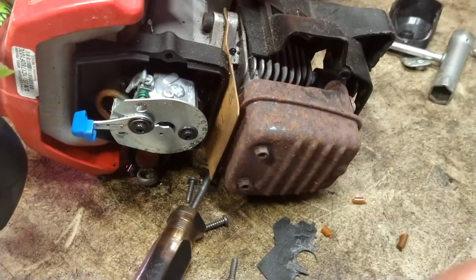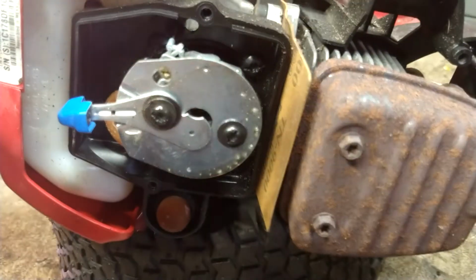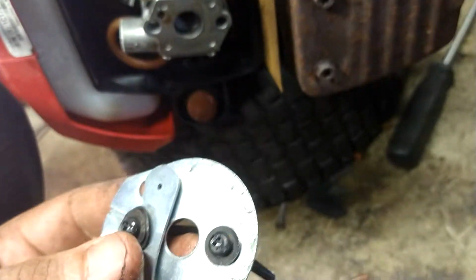So fuel lines, filters, even carburetor if I can find it, everything you'll need for this job will be in the description down below. Alright, now we're going to take out these two T27s or flathead screws holding the carburetor in. Pull it off, just get it out of the way.